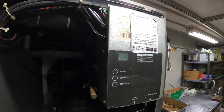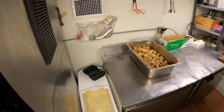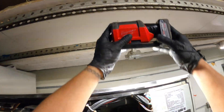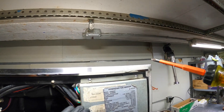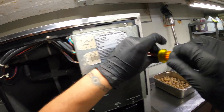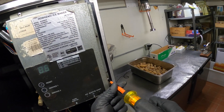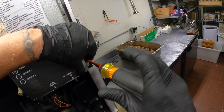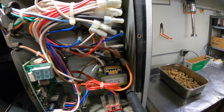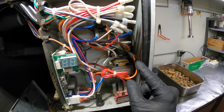Here's our fill valve and our capacitor is going to be inside here. Let's open this up. This switch was to the left, which is in the ice position when it was making ice; I put it in the middle to turn it off. We're also going to need to close our water valve fully. Let's go ahead and take off this electrical panel — not those top screws, only these two screws on the side. So we get to the board and all of the components: control board, switch, fuse, transformer — and I think this is some kind of potential relay, possibly for the compressor.